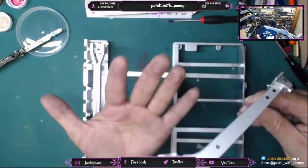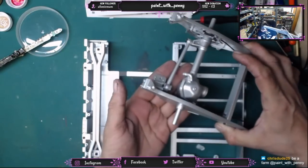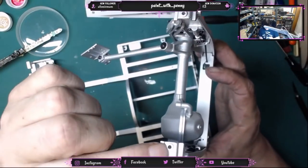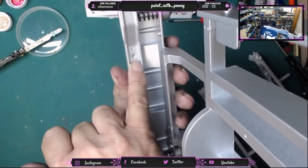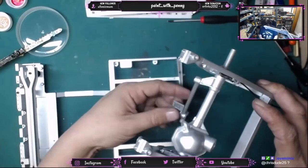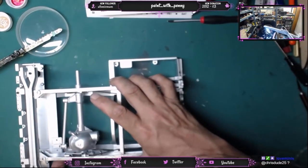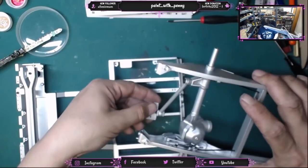Right, so the trailing arm, that's your 5th point of contact. And then what happens is sections 6, 7 and 8 deal with them individually. So just lay it all on. You're looking for lugs, where the lugs fit. You've actually got a total of 12 holes, but you only need 8 screws, because some of those are locating pins. So have a watch of the video, have a look at the magazine, and we're just going to offer up, or as I call it, dry fitting.